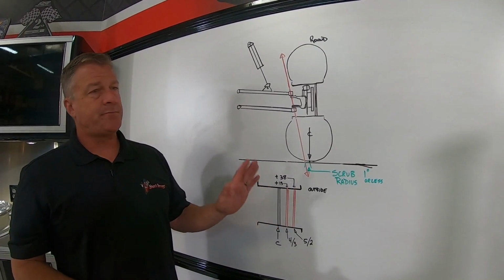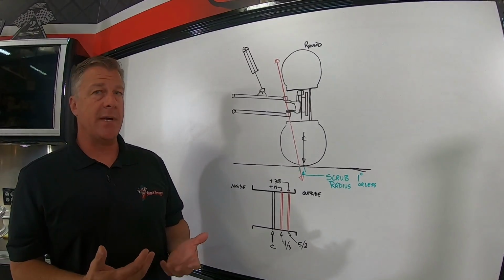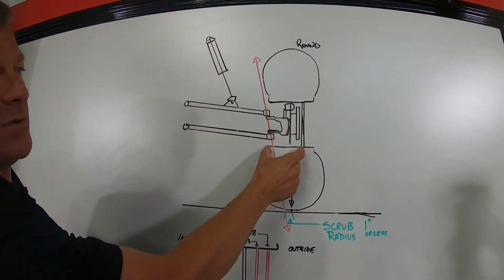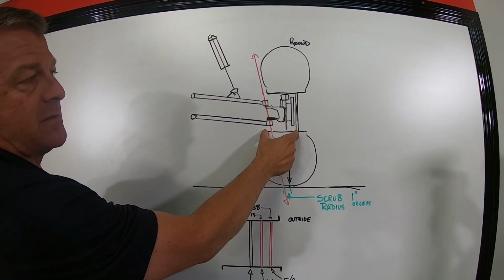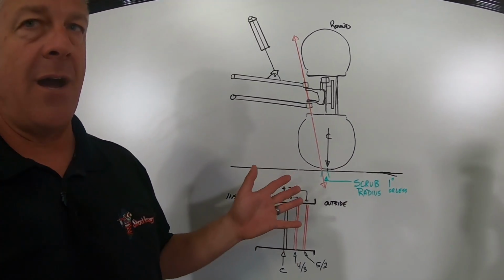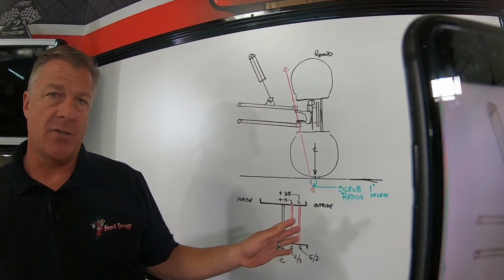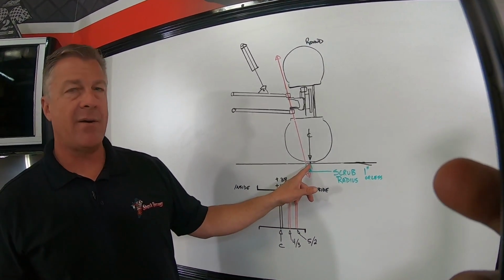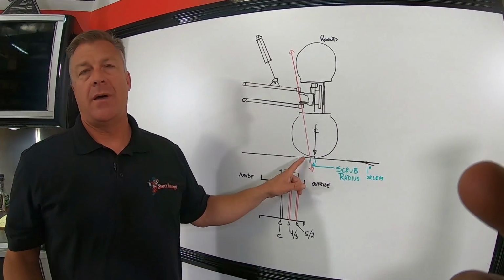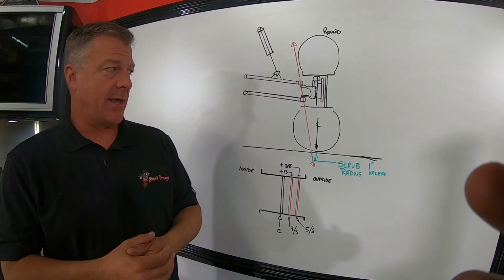So most wheel offsets for UTVs are a high offset, which would be very little wheel on the outside of the hub face and most of the wheel on the inside of that hub face. Most of the factory wheel and tire combinations on UTVs have a scrub radius that's under 1/2 inch. The less scrub radius you have, the less feedback is in the wheel. The more scrub radius that you have, exponentially, the more feedback you're going to get in the steering wheel, when I say that.